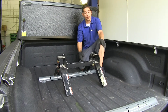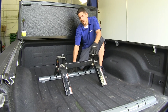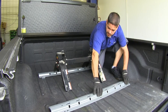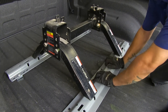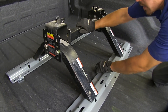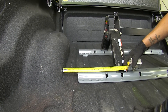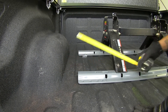To determine the mounting location for our rear rail, we put our base into the forward rail and then slide our rear rail into place, lining it up with the tabs on our base. Once the base is mounted into both rails, we pull the rear rail towards the tailgate while pushing the base towards the cab of the truck so everything is nice and tight and square. We then double check that the rails are square by measuring each side to the wheel well — once those measurements are equal we know it's square.